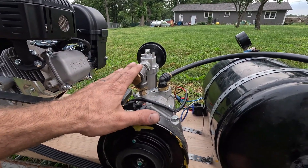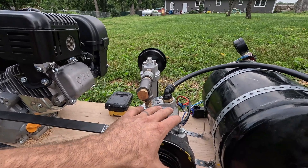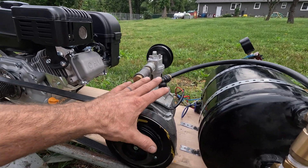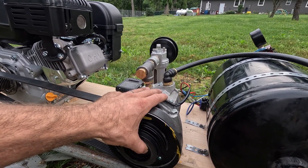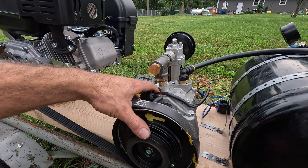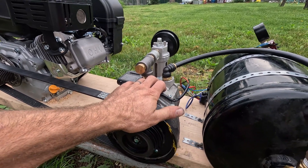Pretty much all modern AC compressors cycle the oil throughout the system instead of the oil just being contained in the compressor. That is kind of a hang-up around using one of these, because if there's no oil in the compressor it will burn up. If you are not feeding any oil to the inside or doing some kind of modification to the guts of this thing, you are going to have issues. I did get some comments about people having success with grease-packing the housing, which is actually a really good idea, but I was looking for an option where I didn't have to pull the compressor apart — something simple and experimental.